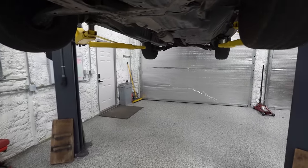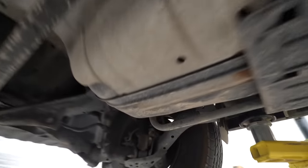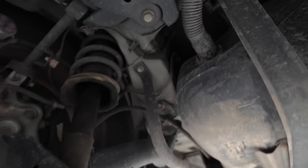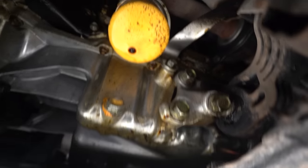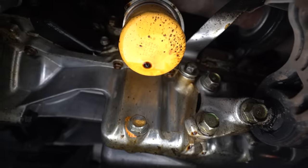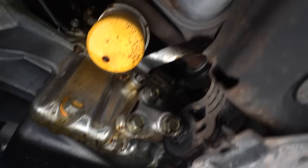I wanted to take a quick look under here with it on the lift since I've never had it on the lift, and it looks pretty clean. As I saw when I looked at it on the ground, we've got no rust. This thing has definitely never spent a day of its life anywhere up north. That is one of the benefits of finding a front-wheel-drive one — it's less likely to have lived up north than an all-wheel-drive one would be. But I did see a little problem: we have a bit of an oil leak. It looks like it goes as high up as the filter seal, or it could be the pan gasket. Either way, it's not terminal, so we'll let that ride for now. Let's get into the brakes.